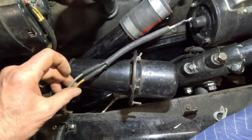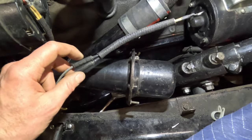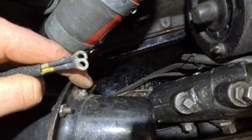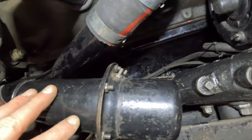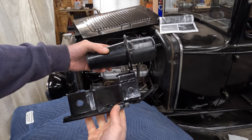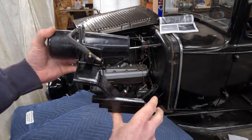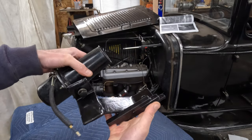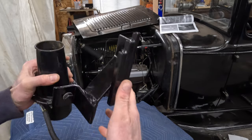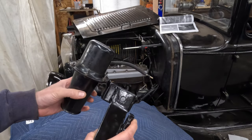There it is, all installed. I'll get leads made for this, get that bracket cleaned up and painted. I made up this little jumper harness — it just plugs into the two wires on the vehicle harness using the same bullet connectors, another piece of that sheathing, and it's got little eyelets on the end that tie into the terminals. This isn't the factory horn — it's probably some aftermarket one, which is why it has different terminals than the bullet ends. I threw a coat of paint on the bracket last night. It's not going to win any beauty contests but it'll serve its purpose — you really can't see it anyway. It's very rugged so flex won't be an issue.